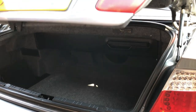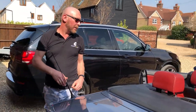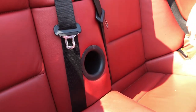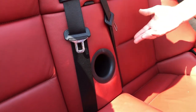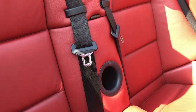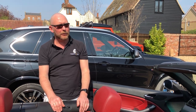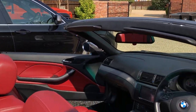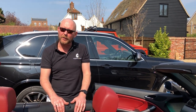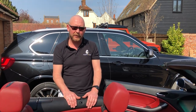We do lots of these this way. If it wasn't a convertible — if it's a coupe — we'd use an enclosed subwoofer which sits in the boot and takes up very little space, but this is a great solution. By venting it through here — not a tuned port, just literally a vent — the bass comes through into the cabin without having to remove the cover, which just pops in and out. The audio system in this car is sub-£2,000, so it's not an expensive upgrade, plus the Apple CarPlay unit at the front. If you've got an E46 and want a bit of hi-fi but want to keep it looking original, give us a shout.